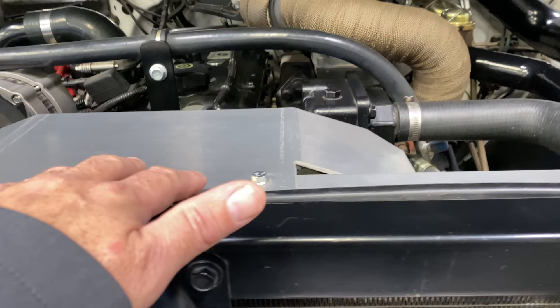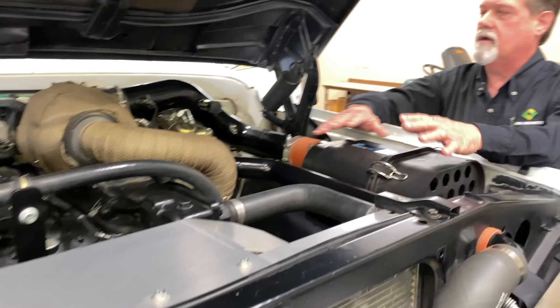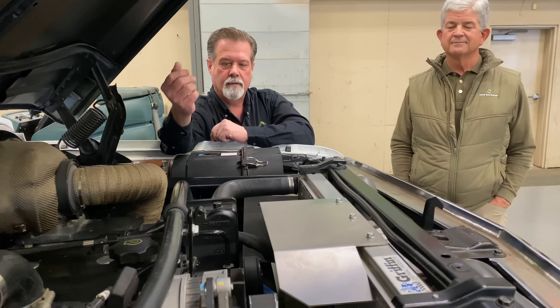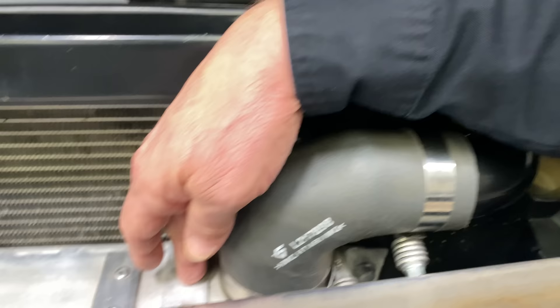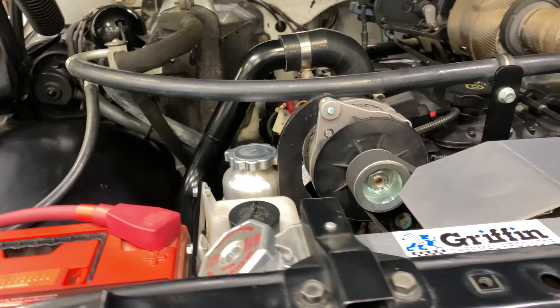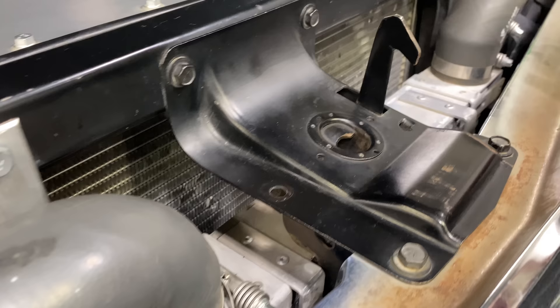You had to make the shroud, right? Everything is custom-made — the whole thing. Other than the engine itself, everything is fabricated: the exhaust, all the intercooler tubing, all the cooling system. The radiator is a cross-flow aluminum but the fittings all had to be modified. The whole AC system is basically from scratch. This is coming out of the turbo, going in being intercooled air-to-air, and then out and up to the intake.